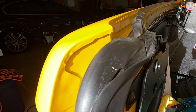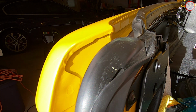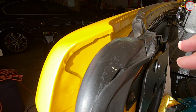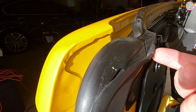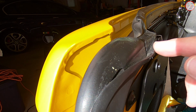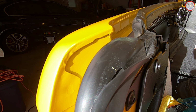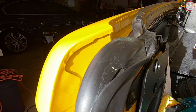So then I usually leave the cargo cover up while this is drying, and after it dries, like I would say 12 to 24 hours, go ahead and use the cargo cover normally, and it should just leave it in this position. It shouldn't break it or anything. And I put this silicone sealant in here in early 2010, and as I record this video, it's December 2018, so this has lasted very well. So that's the top area where the 3 different body panels meet together and the seals for them.